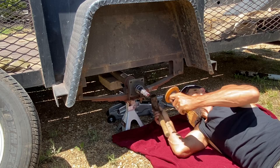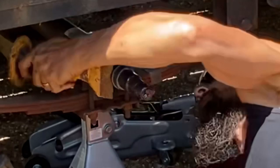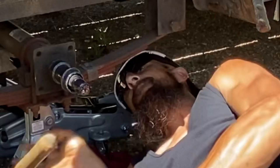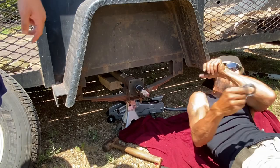When you have to beat this race off the axle, make sure you do it side to side at an even distribution as you wobble back and forth. If not, you'll seize it up and you'll be cussing pretty quick. You've got to make sure that race comes off — it won't work otherwise.